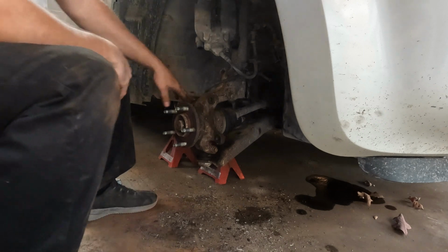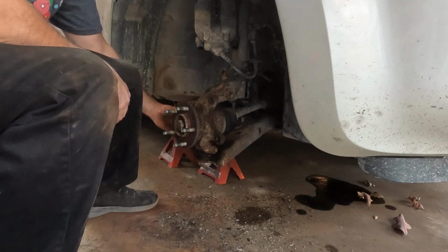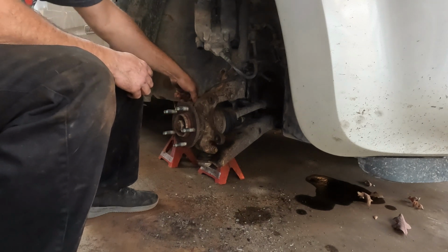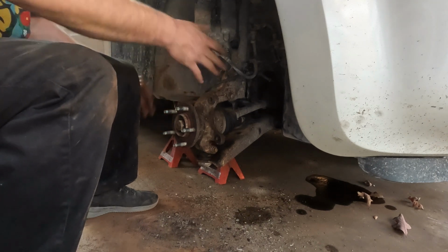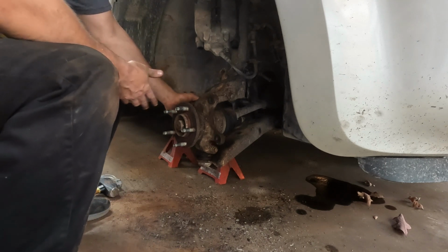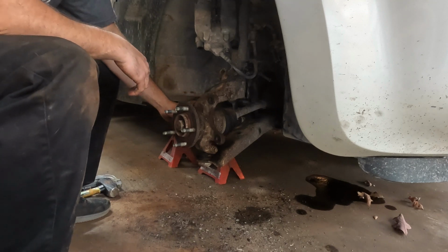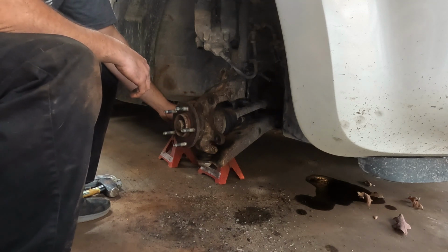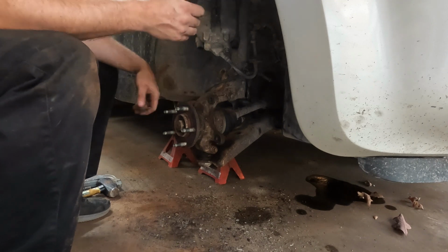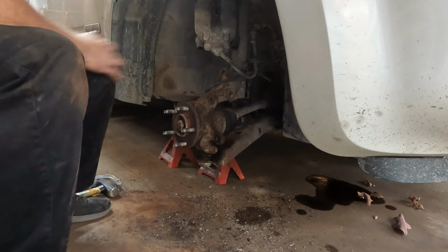The only thing that was a real problem for that was when the tie rod went back in, I tried to tighten it, the stud spins, because it's a ball joint. It's completely smooth inside to allow the motion that it needs. It's a nylon lock nut and it's a rusty stud, so it didn't really want to go on there. The stud itself does have a hex head at the very end of it, so you can hold the stud with a wrench and then turn the nut with another wrench. Mine was messed up right at the end though, where that spot was still hidden.